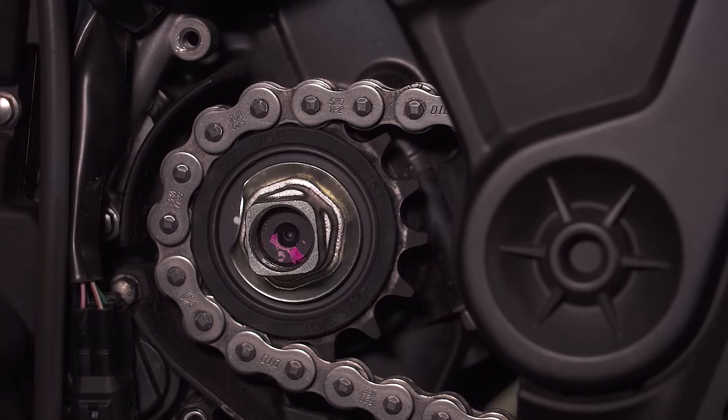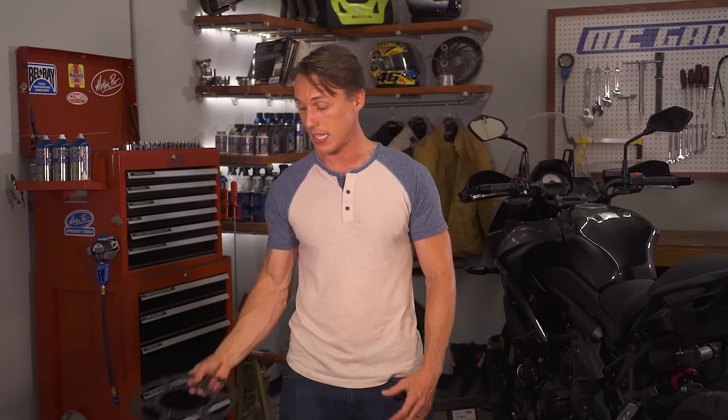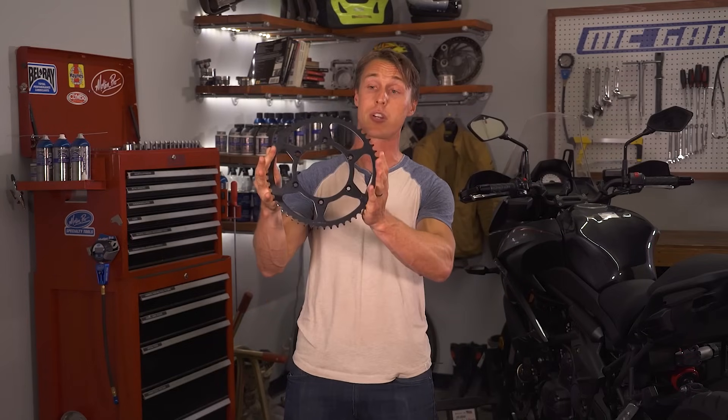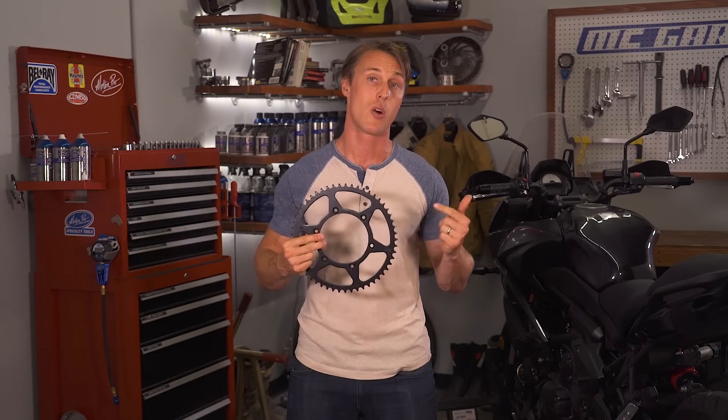For the most part, people tend to gear their bikes shorter since most motorcycles today come with excessively tall gearing. But even if the gearing on your bike feels way out of line for the way you ride, you're probably not going to have to make a big change to notice a big difference. In general, folks are going to change the front sprocket by one, maybe two teeth, and alter the rear by two or three teeth max. Big pie plates like this honking 53-toother do exist, but the only people you'll see using them are stunters or hill climbers.